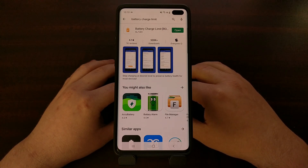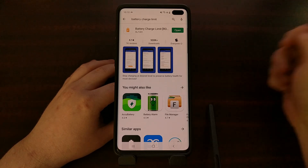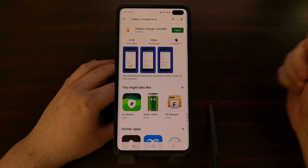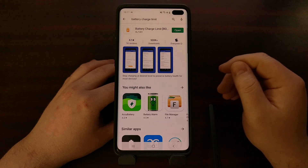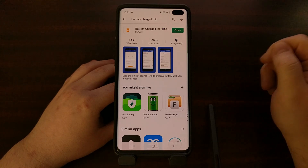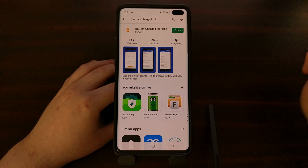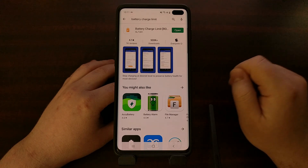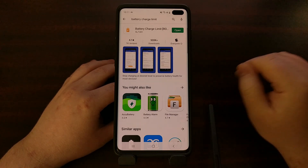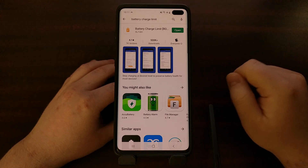The levels at which you allow your smartphone battery to sit matter. If you run your battery to zero and then set it on a shelf for a month, two months, or even just two weeks, there is more damage being done to the battery at zero than if it were kept at 50%. That's why it's always advised that if you're retiring a phone, tablet, or laptop, charge the battery to about 50%, turn it off, and put it on the shelf.